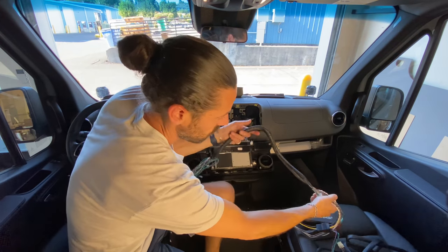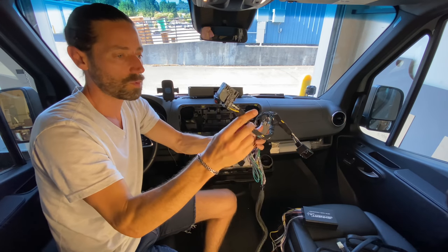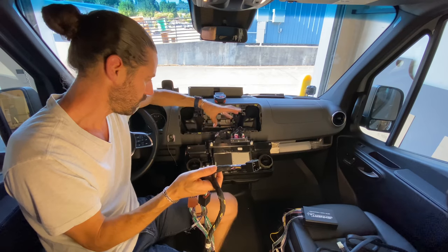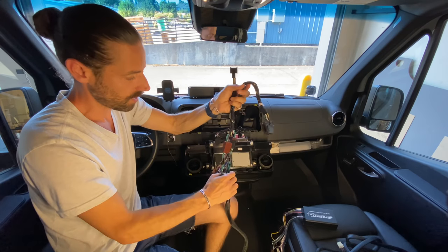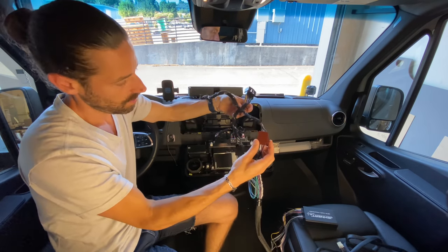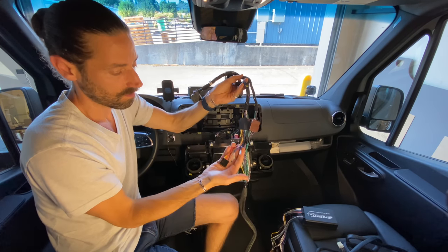That is the connection of the center harness. The other end of that harness connects to these taped wires with cloth wire tape, which is what plugs into your head unit. The head unit is dropped back out of the Sprinter now and hanging down. Your green, purple, gray, and white with the brown harness goes to the brown harness on the amp. Then these two harnesses together plug into the large harness here. The remaining wires are not used in this application.